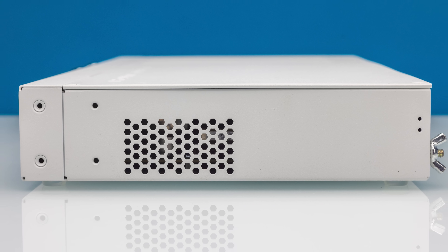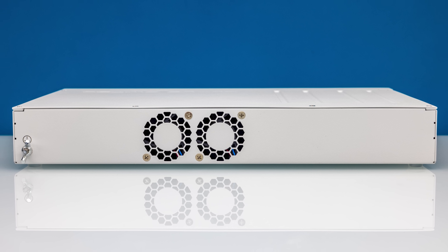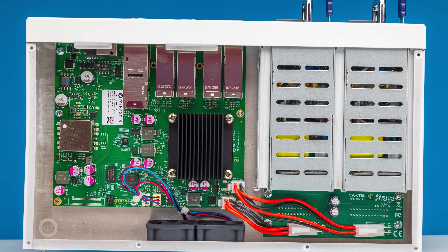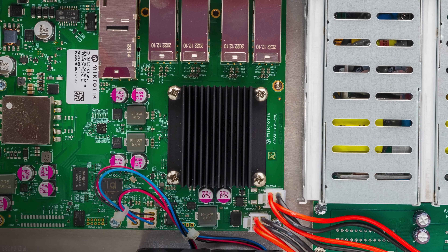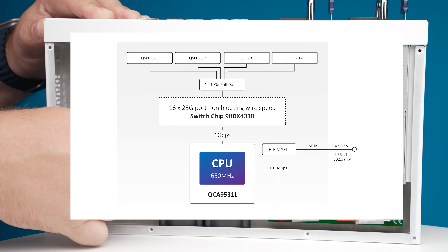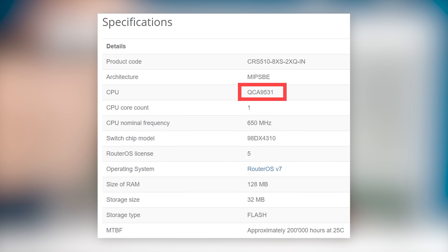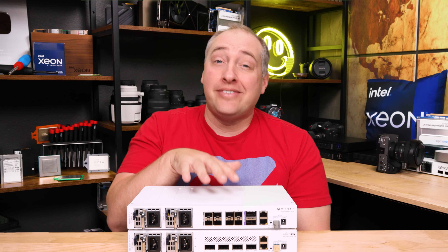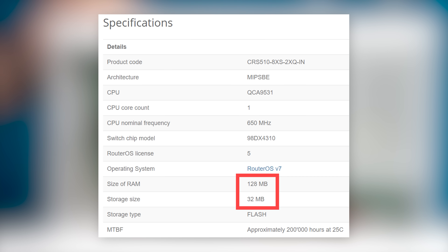On one side you have room for rack ears and a little vent; on the other side you also have room for rack ears. In the back there are two fans — and to me that's the one thing I wish this switch didn't have, though the good news is that since it's a low power device, those fans tend not to spin up too much. Looking inside the switch, up front we have our ports, off to the side our power supplies, and in the middle a giant switch chip — the Marvell Prestera 98DX4310. That is a 16-port 25 gig ethernet non-blocking switch chip, with four or eight of those ports presented as two 100 gig interfaces. The management processor is a QCA9531 — not a newer ARM version, but at least there is some management. One thing that is different from the CRS504: the RAM and storage space are doubled on the CRS510.